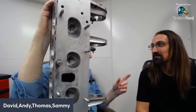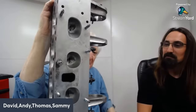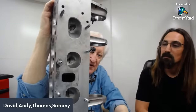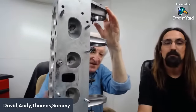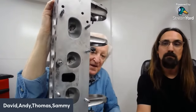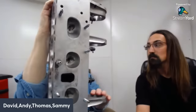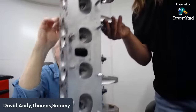Now, you were saying your box allows you to time all these cylinders differently. Yes. I bet you find 30 horsepower there, because one of them is 4 degrees different to the other. The bad burning cylinder, which one is it? This one, the bottom one. The swirl is almost non-existent. It's a slow burner, and we don't have much time to burn it anyway. But yeah, go and stick that in my shop then, Thomas. Absolutely. And we'll take a look at that.